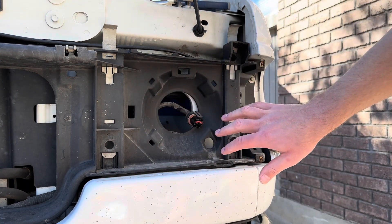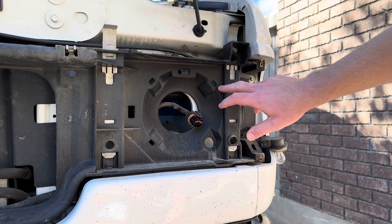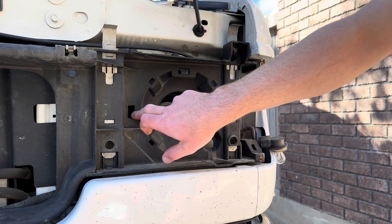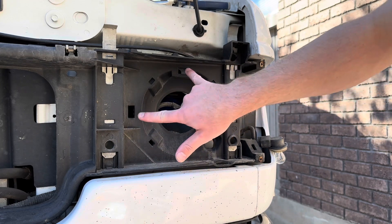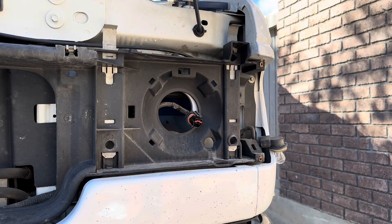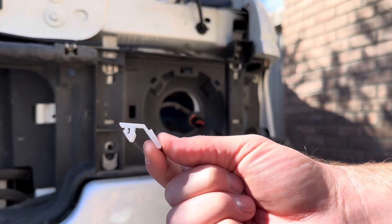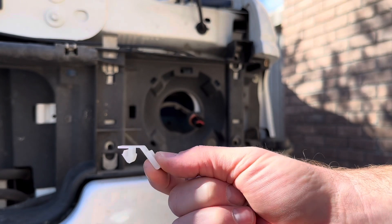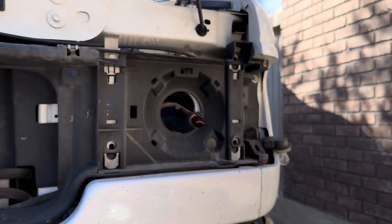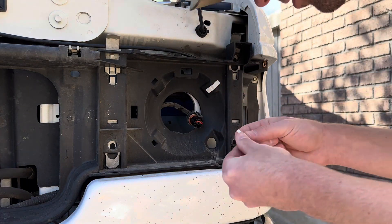This grill piece has what looks like everything we need to put the sealed beam lights in. We've got a couple of clips where the white plastic pieces go, and these rectangular holes are where the screw adjusters go — there are two of them. That spring mounts down here. The white clips are just little pieces that help the buckets adjust, providing a slippery surface to reduce friction. These should just slip on right here — I believe there are three of them for each side.